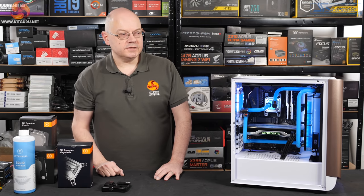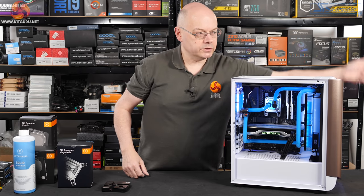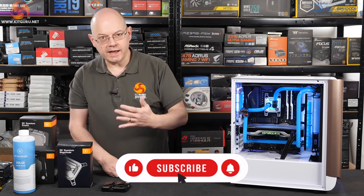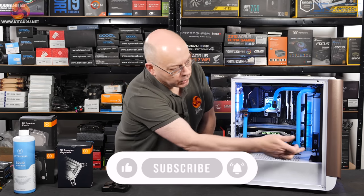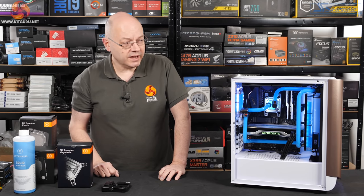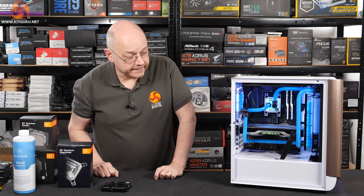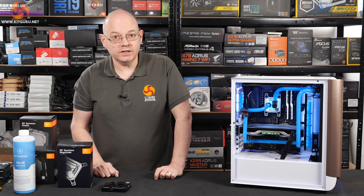At the front of the case, you've got this involved front panel drawing air in from the top and the bottom. The two 200mm fans are then pushing the air through the radiator. That I think is working successfully. And I have then blocked it with the Kinetic pump reservoir unit. Airflow is hurt, there's no denying it. By eye, and I've reviewed a fair few cases now, this chassis looks perfectly competent. It will, I think, if you build a sensible system inside it, do a perfectly decent job.